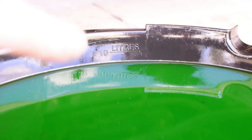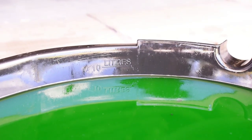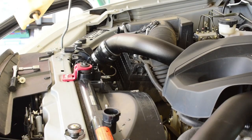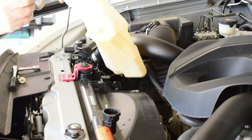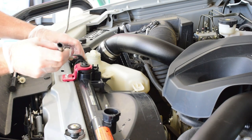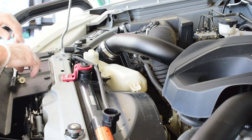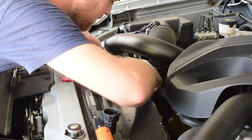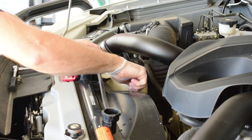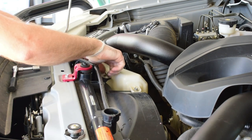Now I've drained out that reservoir and I have pretty much 9.5 litres in my drain pan, which is perfect. That means I've got all of that old coolant out of the system and now we can replace it with fresh coolant. Before we fill the coolant back up, I've just got to fit my overflow bottle back to the vehicle. I'll just route our little hose here and pop that back on, then put our two 10mm bolts back in and make sure the bottom little mount on the overflow bottle is sitting in the radiator support. Tighten these up and we'll be ready to fill the cooling system.